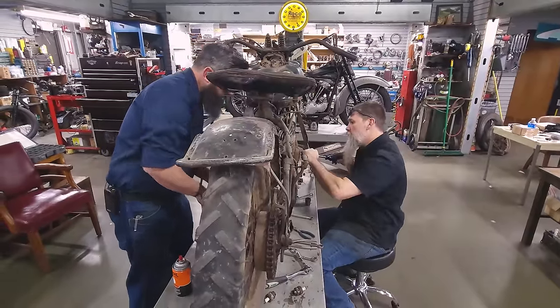The bike runs! You can hear it needs back pressure — hear how flat it is when we're revving it. We'll try and dig out a muffler; it ought to be easy enough to install. I think I'll have to loosen up that skid plate. I think I got just the muffler for it. Then we can take it out and ride it, hopefully. So we need the muffler. We need to fire it back up and see if we can get it in gear. And if we can get it in gear and go ride it, we just got to pray that the tires don't blow out.